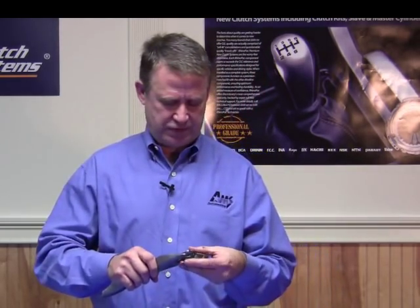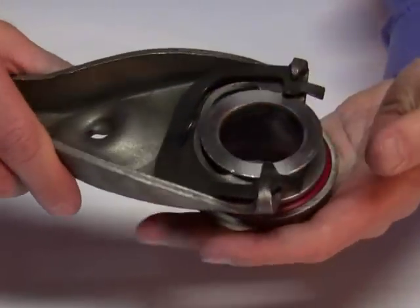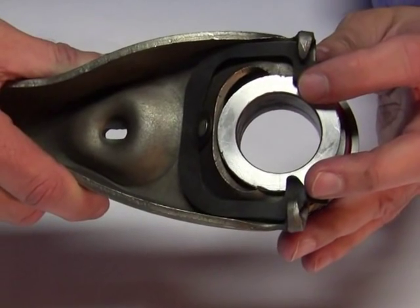Let's look at what can happen if it's installed wrong. Installing it wrong is easy. The release bearing snaps easily into the clutch fork, but notice that the spring clip location is different. You can see the spring clip over the back of the release bearing when it's installed wrong. Remember how this clip looks in this position. There's now a gap between the clutch fork and the release bearing.